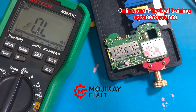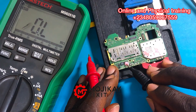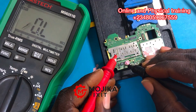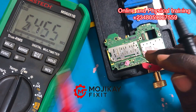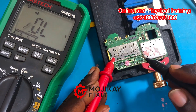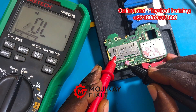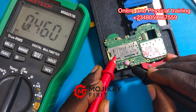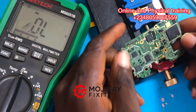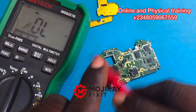Before we go ahead, we need to get our multimeter. Put your multimeter on diode mode and take a reading of that diode, because that's the line that goes to the LCD connector that triggers the light. Measuring the diode — the diode is good. This is a good reading. If you don't get this reading and you get 0.002, there's a short on that diode.